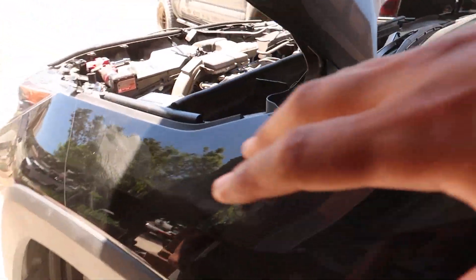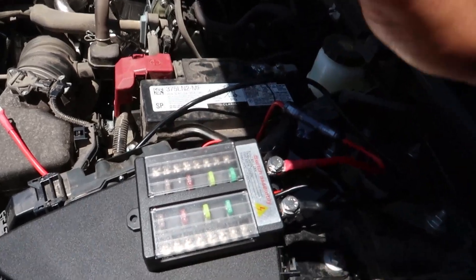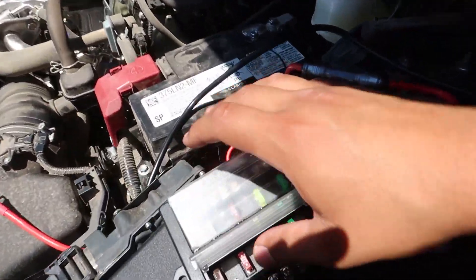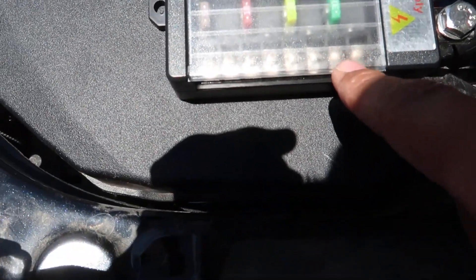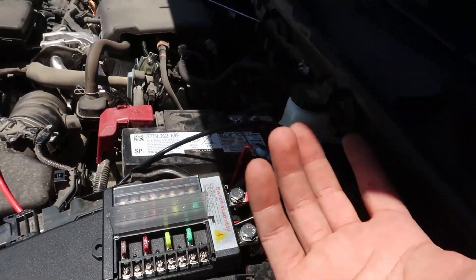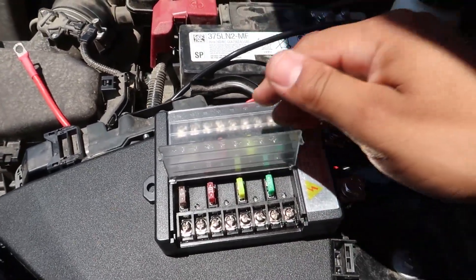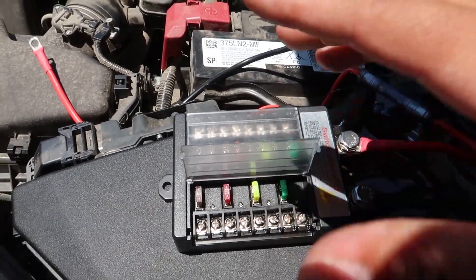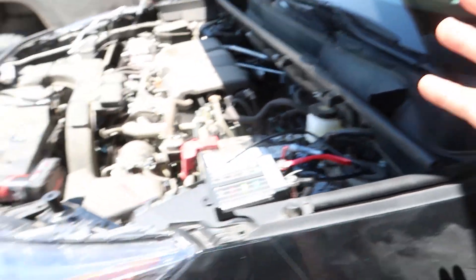Now that we have it all installed and everything put back inside, all we have left is the positive and the negative that connect to the actual battery — super simple and we're done with the install. Once you're done make sure to stay tuned to our following videos where we install the actual pods and everything to light this thing up. Just so you guys are curious — you're going to notice there's plus and minus, plus and minus, plus and minus along the way on both sides. When you're connecting your actual pods, you don't need the relay harness or anything like that anymore — you literally connect the pod directly into the positive and negative and this acts as your relay and your switch and all that. That's the cool thing about having a switch panel like this.